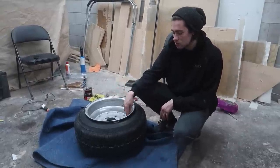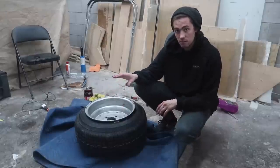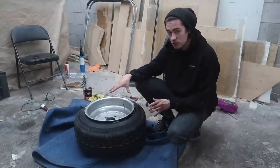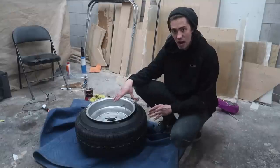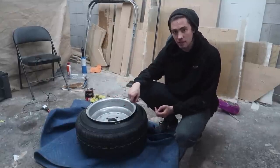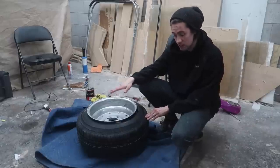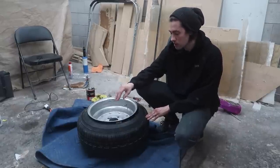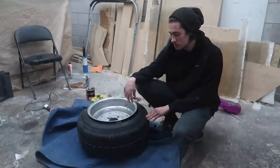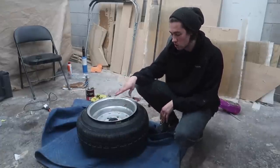And the thing is with these wheels, they've been bent twice now. And that is because the tire machine literally cannot grab onto this thing tight enough. These things were popping out of the tire machine and bending the lips. Thankfully, I have a local company here who took care of this wheel, which was the worst wheel. A lot of them had just slight bends. You can see that this one still has a little bit of bend, but they took care of this wheel. This was the worst one.